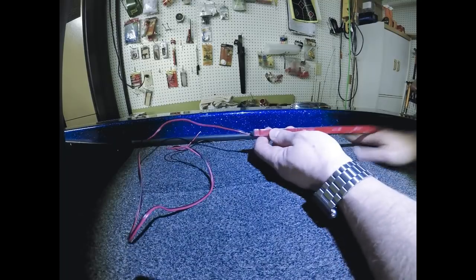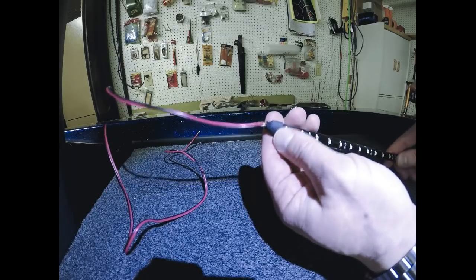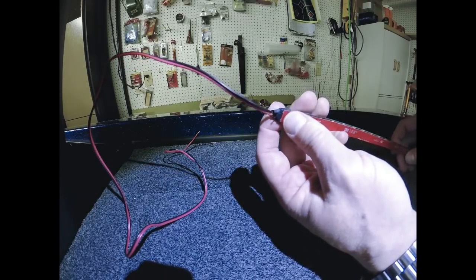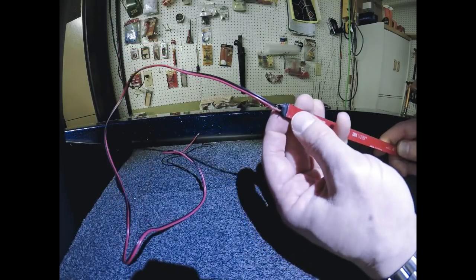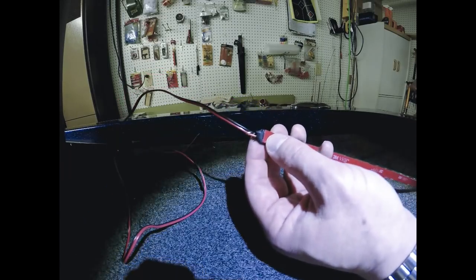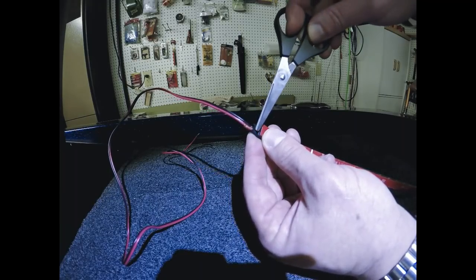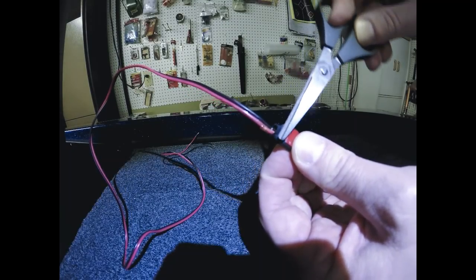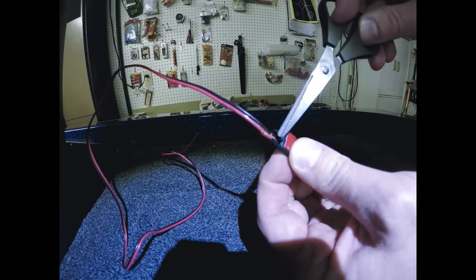And that's the last tip I'm going to give you, which is the wiring. On the back of these Bluewater LED strips, they have these black caps. They're like rubber caps, for lack of a better word, on both ends. The end with the wiring, I actually got this tip off of a Bluewater video, from the Bluewater company. On the back, you can take your scissors and notch out, hopefully this shows up, a little piece of this black cap. I'm going to get it as close to the camera as possible so you can hopefully see it. That was a solid one piece like that. I took my scissors and I notched it down.